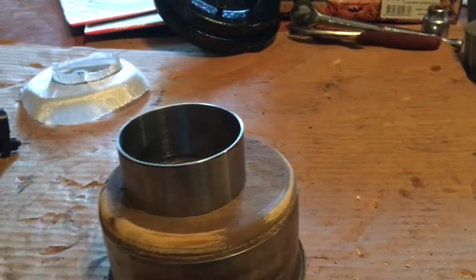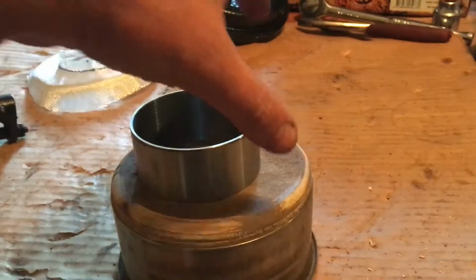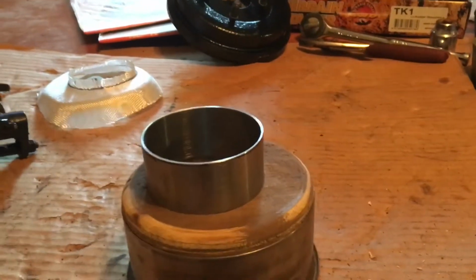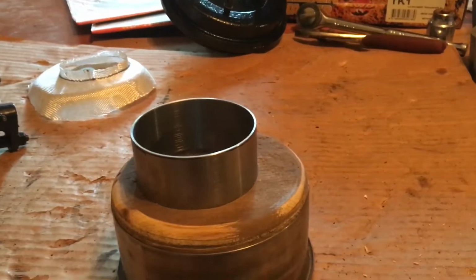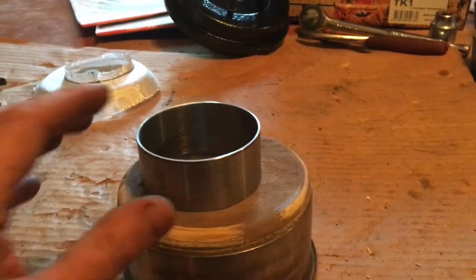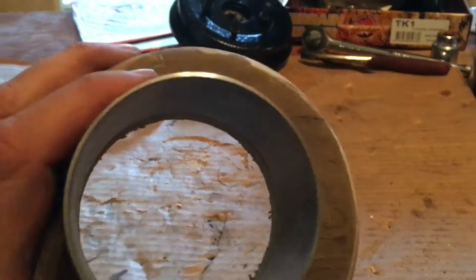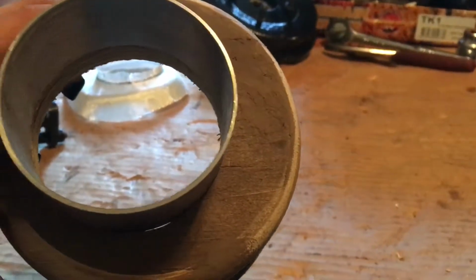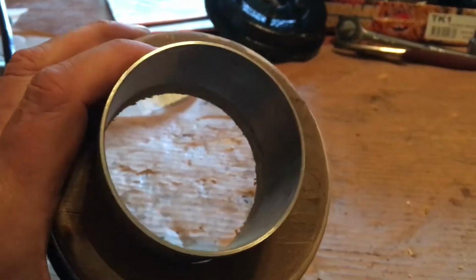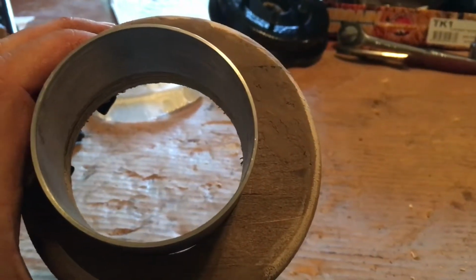So it'll almost be out of sight. You won't even know it's there. But that will be how you remove this device. It'll be clamped down with those 2 bolts, and you can take it off. I can maybe use some quick disconnect, or just use 5/16 bolts. Probably 5/16 bolts. Anyway, the air cleaner housing will clamp around this metal ring. I had that metal ring made. I could have made it myself, but in the interest of time, I just paid the machine shop $35 to make that metal ring. It's 3.062 inches on the outside and 2.992 on the inside.